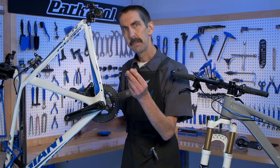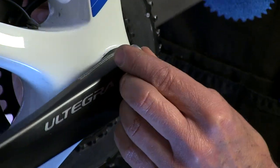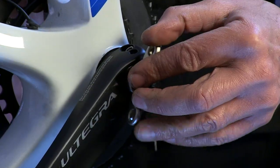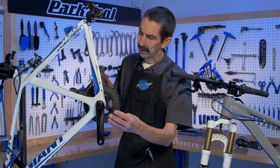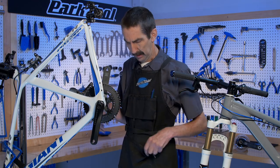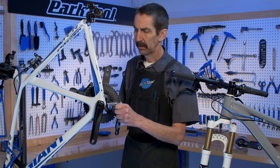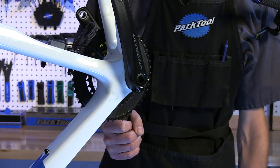The adjustment is just finger tight. Put the tool in the cap — just a couple of fingers, about four inch-pounds, sometimes not that much. You bring the crank arm over to the bearings but not into the bearings. Then secure the pinch bolts to the manufacturer's torque. Check for play and you're done.